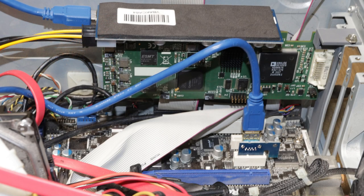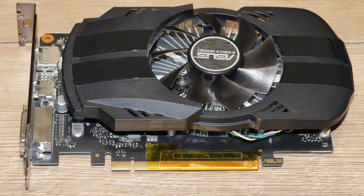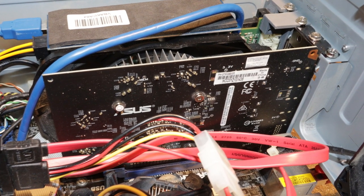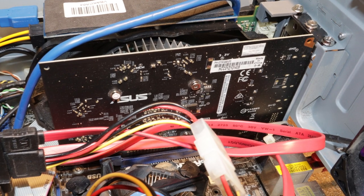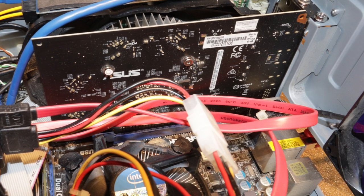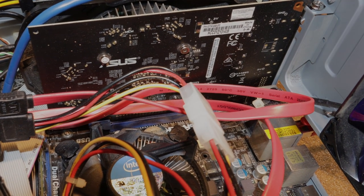Last night, I forgot to get to a final conclusion. Let's see what I was able to achieve compared to what I've planned. The GTX 1050 is able to encode multiple streams, and I also managed to connect the capture card. It seems a single PCI Express lane is enough for the capture card. That way I can record the full HD output of the G4 PowerMac. All in all, the build is a mess, but it is working as expected.